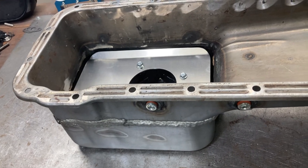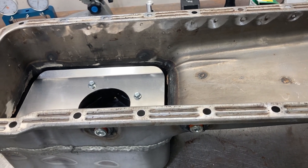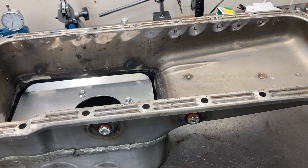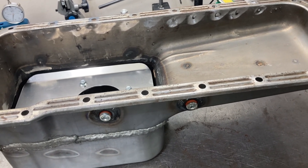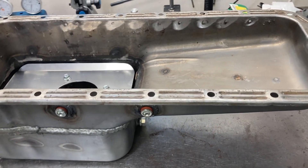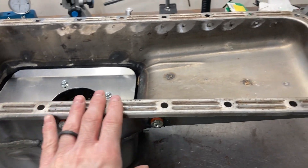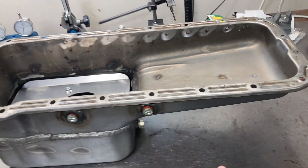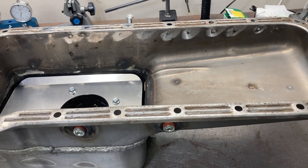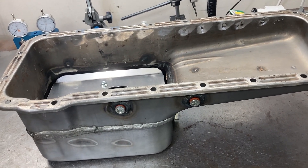Pickup trucks, four-wheel drive trucks, aftermarket front ends with rack and pinions in different spots — all of that matters. A lot of customers building engines with rack and pinions or a Mustang II front end will require a rear sump pan, which isn't something you see too often on a Ford FE. But most oil pan manufacturers — Canton, Milodon, Moroso — will make a rear sump pan for those situations.